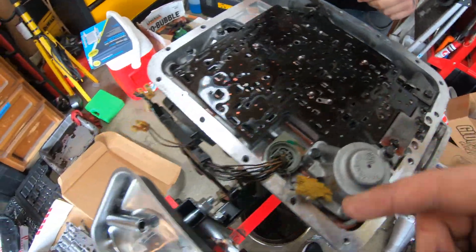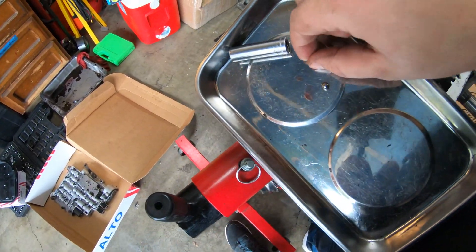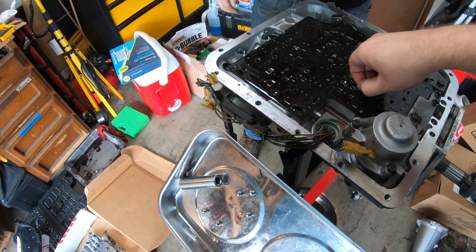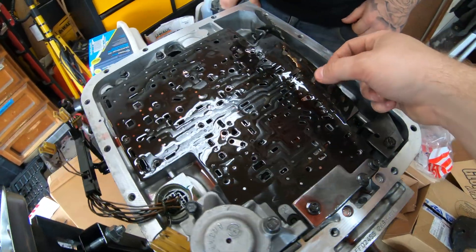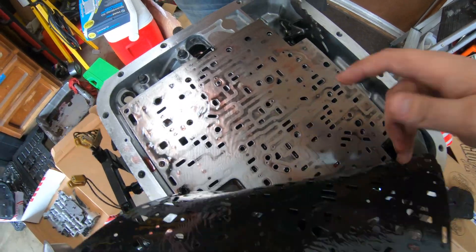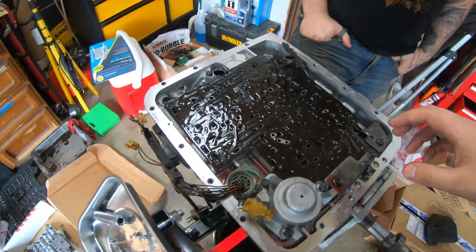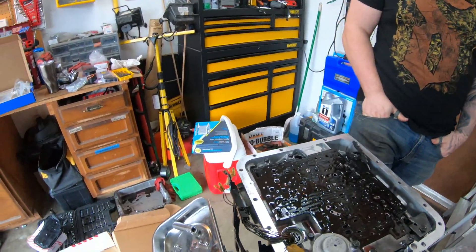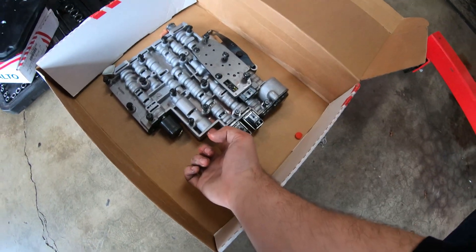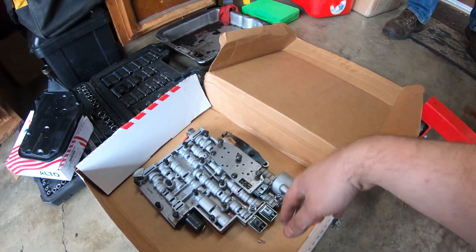You can see all these little check balls. I took some photos — remember where those go. I'm just going to grab a magnet and keep them in our magnetic tray. Do not drop them in the hole. We're just going to remove these plates and the accumulator, then we can take the gasket off. There's a steel plate that we have to do some drilling on in select places, and below that I think are some more check balls. Probably just take out this second accumulator, whatever plate this is, and then start following the instructions on what springs and whatever else needs to be replaced. We need to flip this over because that's where the pistons are behind the solenoids.